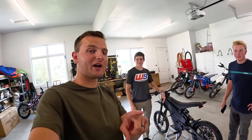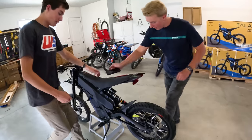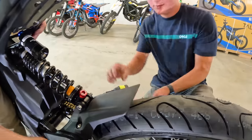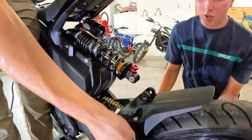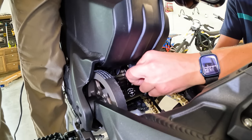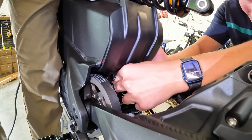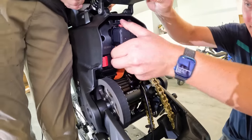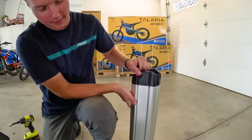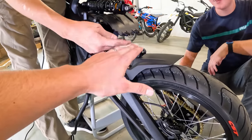It is time to take out the battery, because everybody's complaining that it's way too hard to do and takes way too long. So we're going to turn on a timer and take it off for the first time. Ready, set, go. All you have to do is take off this bolt — we're using an impact gun, which does make it slightly faster, but a wrench is also pretty quick. Boom. Drop that out of the way. Now you just take off these quick releases on the battery, spin them so they're loose, and they'll fall off just like that. Boom, pop that up, unplug the battery. At the same time, you have to have your buddy lift your bike up. All the way out. What's our time? 42 seconds. You don't have to remove the rear wheel — all you literally have is one shock bolt, and it's super easy to do.